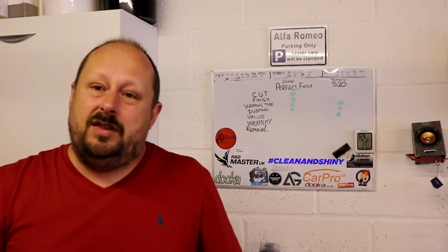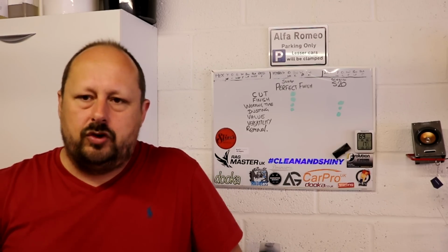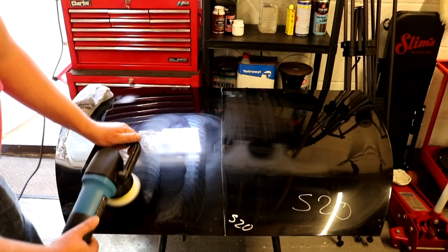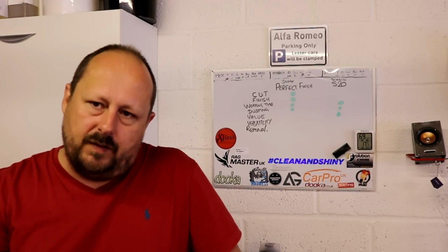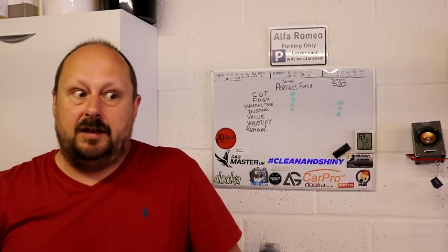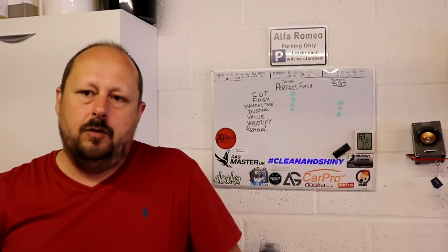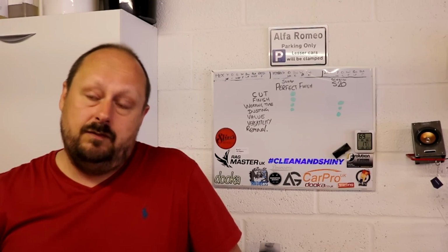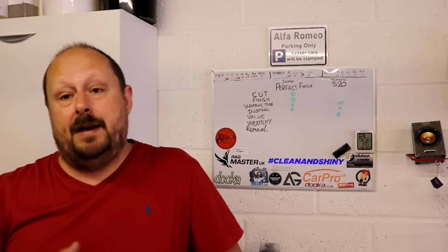Scholl. The only thing is, when I use the dual action polisher and I'm not really using much pressure or anything like that, I'm just letting the machine work slower over the panel, making sure it's virtually spinning at top whack to get the most out of it. The Scholl just seemed to allow me to go a little bit longer with that, but the knock-on effect was I was probably doing less cutting. So even with the dual action, if you want to get the most out of the cut, you've got to get a bit of pressure going on the flat panels.